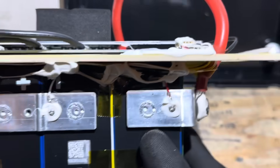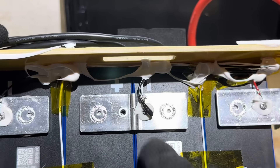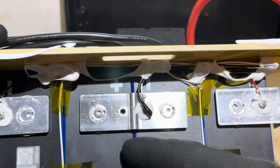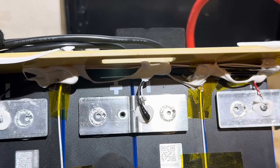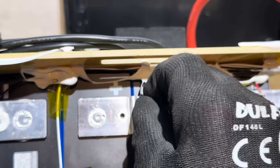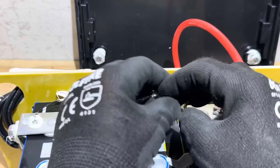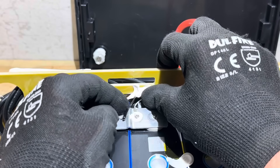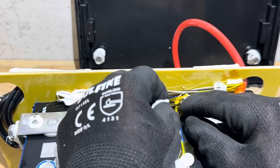Here's the NTC thermistor — it runs along underneath and sits right under the bus bar hump. I wanted to know if it's glued down or just sitting there, and it's just sitting there — the sensor is not attached with sealant. It has direct contact with the cell sitting up underneath that bus bar hump. Normally you see them glued down in the center of the cell pack to get a good temperature reading from the center of the cells. Not sure why they placed it there, but just showing you everything I'm seeing. I went in and cut the sealant loose — they had glue against the top — and there's tape underneath; the sealant was on top of the tape, so it pulled a little loose, but it wouldn't have come loose on its own under normal use.